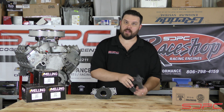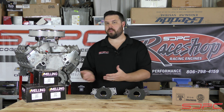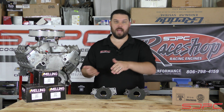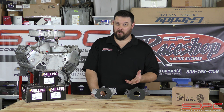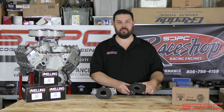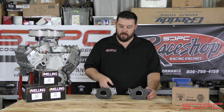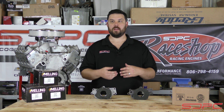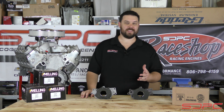So why are we holding a Melling oil pump and standing next to three Melling boxes — standard volume high pressure, high volume high pressure, and the extra high volume 10-355? There's more to it than just volume. The factory oil pumps start to cavitate around 6,200–6,300 RPM — they can't pull oil in and push it back out fast enough. The factory pump runs about 6.8 gallons per minute but starts to drop after that RPM. The Melling internals are designed to counteract that through better efficiency, which is also why we offer ported versions of the GM pump — and coated-and-ported options — to improve fluid flow and reduce drag.